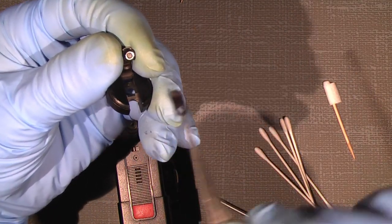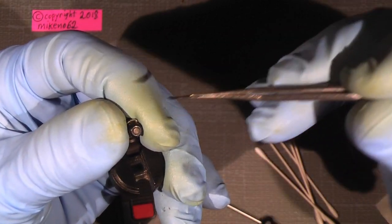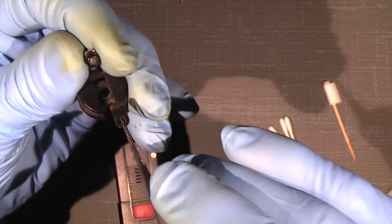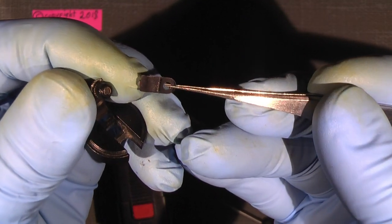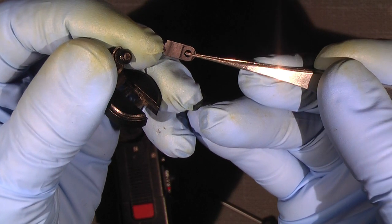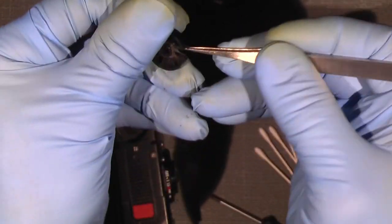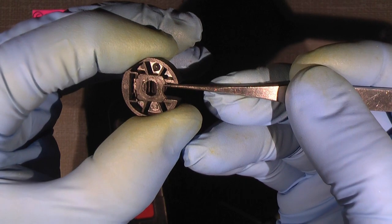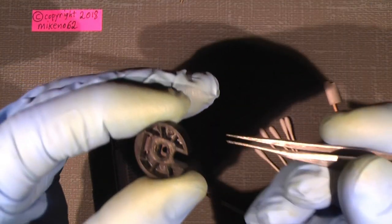This is the spring that I talked about taking out. And remember how it should face. It should face like this. So the curve of the spring is actually upward. So when putting it in, it's just like that. There's also a tiny pointy end in the end of the spring here that needs to go that way in and then bend it a little and put it in. And then it will stay there.